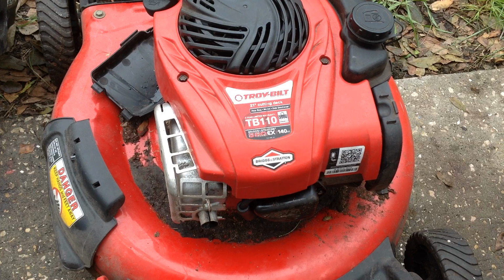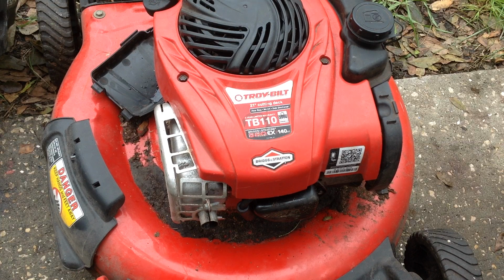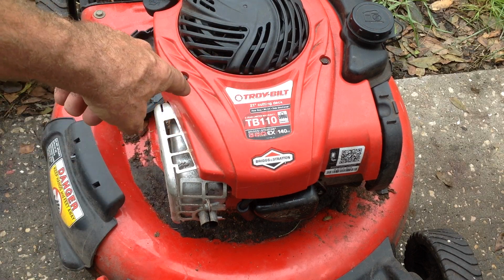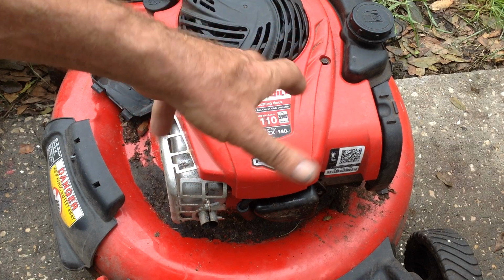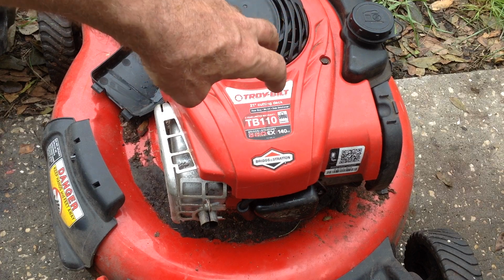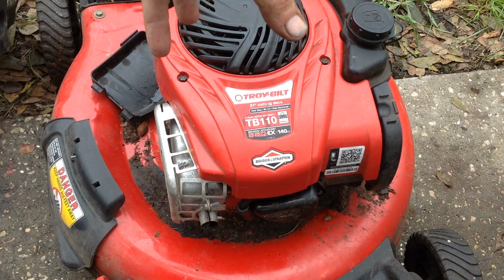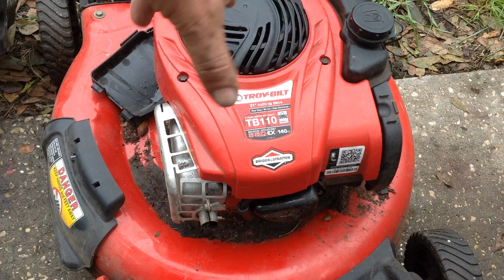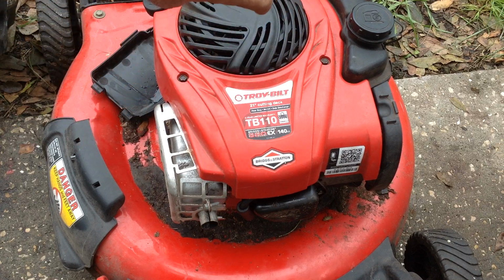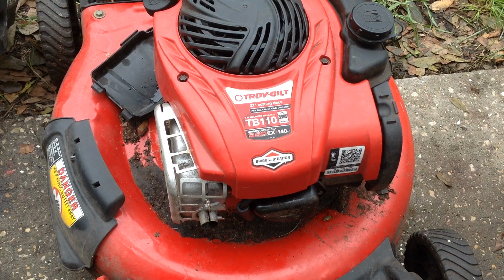Okay, it was doing the same thing for me when I lost the video halfway through this whole session. It would run and cough like that and then finally die out. Before I put the recoil on just now, I spun the flywheel, and it seems to spin easy versus the 2018 I'm working on. The 2018, it comes to like the compression stroke, and it's hard to push back. This thing here, you can just turn the flywheel and there's no resistance. So I think there's internal damage.